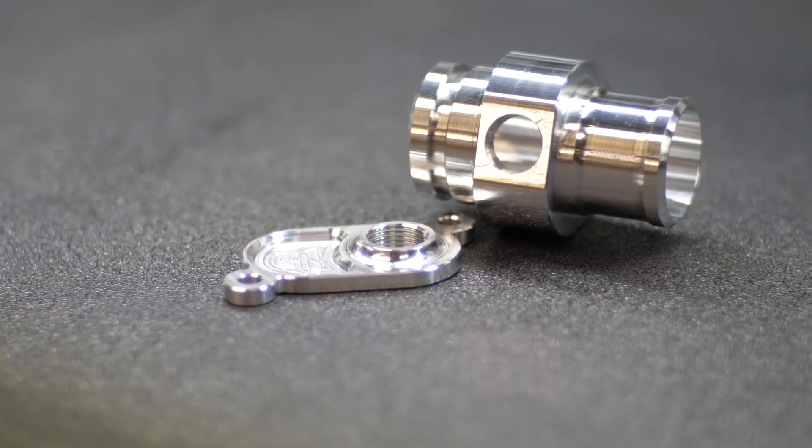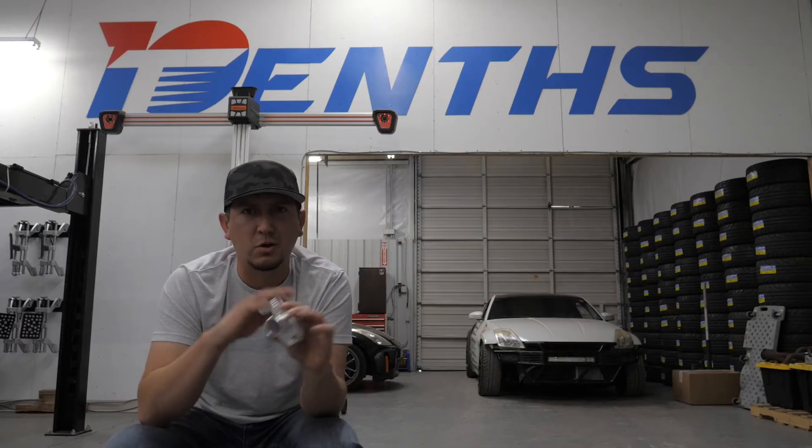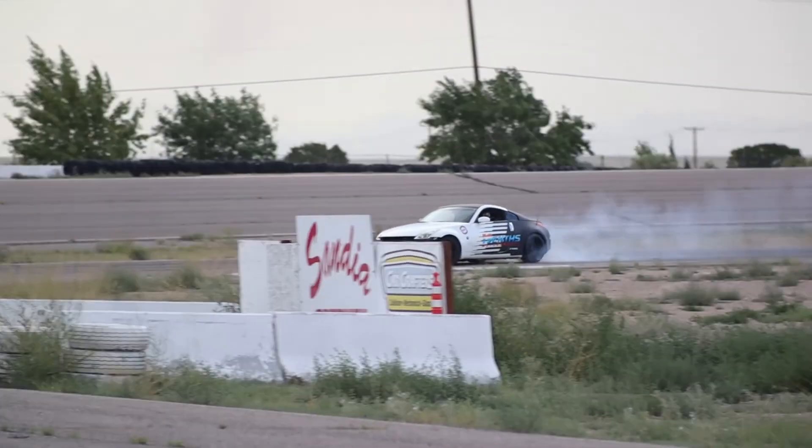It also gives you an easy fitting access — for example, turbo guys who want water cooling for their turbocharger. These two fittings are half-inch hose barbs threaded with 3/8 MPT, so if you want an AN fitting or anything like that, you can pick whatever fitting you want. If you want something stylish or just a regular hose barb like the kit includes, you have that flexibility.